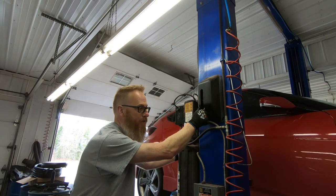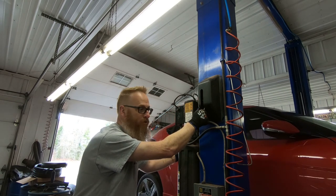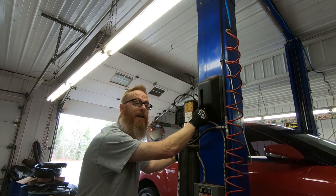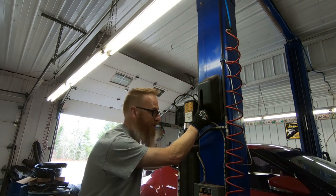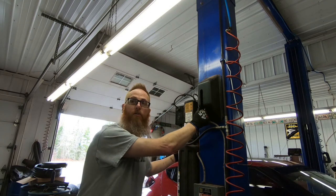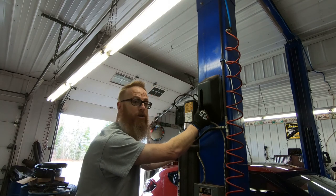We got that job done. The passenger side went very easy, but the driver side was a little bit more troublesome just because I couldn't get the tie rod off — it didn't have the flat spots to use that special tie rod tool. I ended up taking the control arm off. Anyway, it is what it is — four new tie rods. We're just going to take it over to the wash bay and give her a bath so she looks clean when I take her back to Mama.